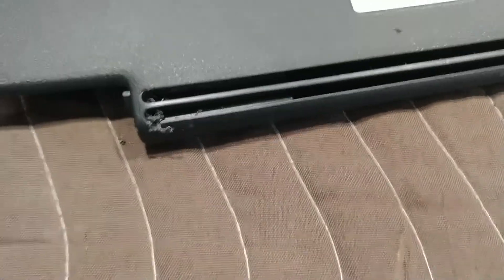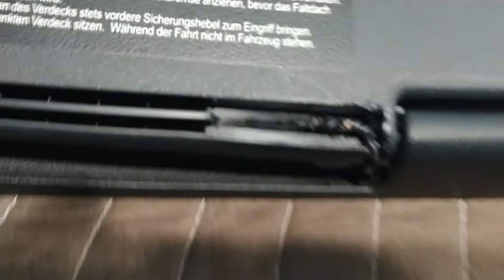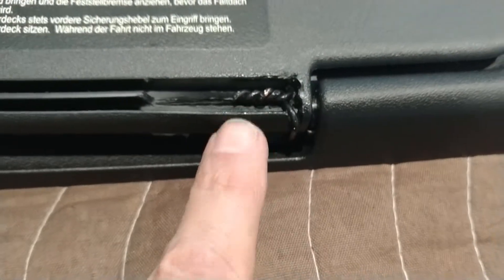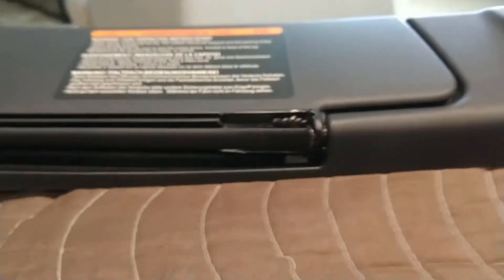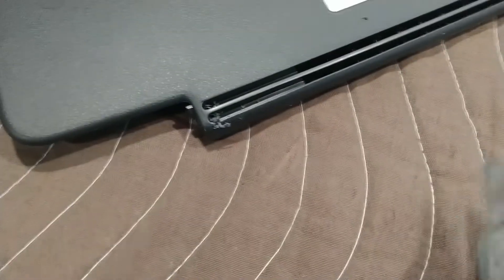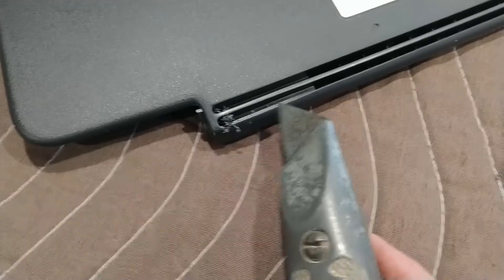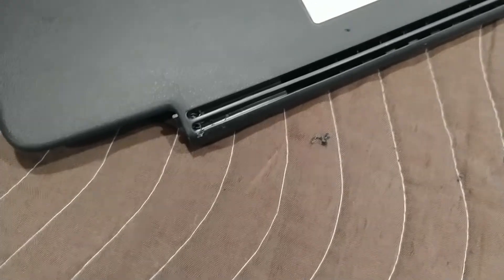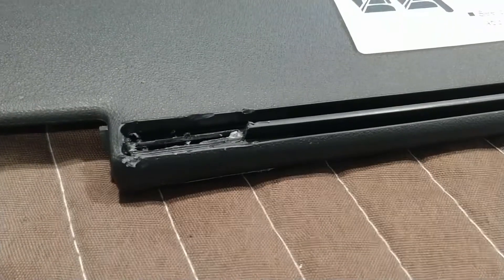Now that you have that drilled, you want to clean up this rib. You want to remove this rib back a little bit, as I've done here — see how I took the rib out? That way you've got an area for your wire once you get it twisted, so it's out of the way, not riding high on the sun visor so that it won't catch as you're closing it. How I remove that rib is with a sharp utility knife — get it in there, and the end pieces you can cut with small side cuts or continue to work out. If you have a Dremel tool, that'll also work. And there it is with the rib removed.